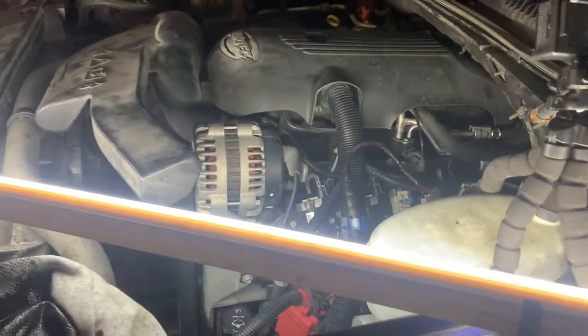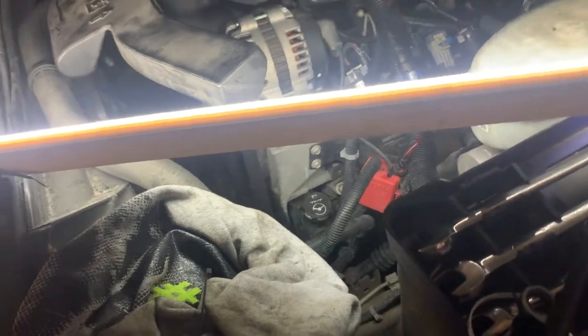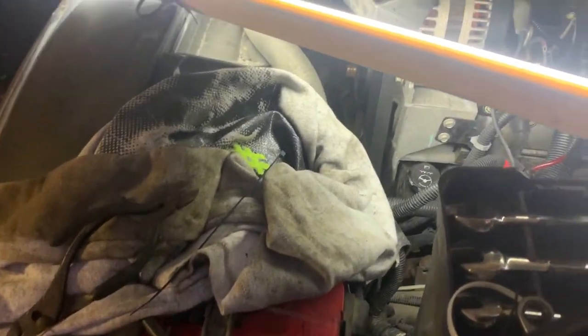One thing. Oh, those little rubber grommet things. Just pull the old ones off. They're kind of hard to get off. To get the new ones on, I found it easiest to spray them with some penetrating oil, slip them on your bolt first, and then put them in the valve cover. That seemed to be the best way to do it.